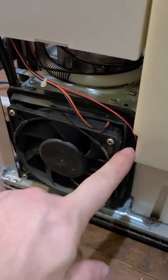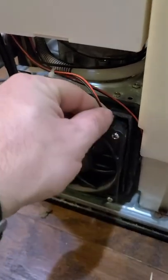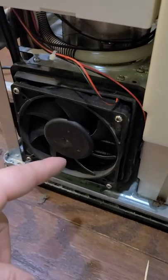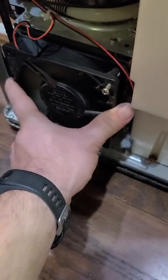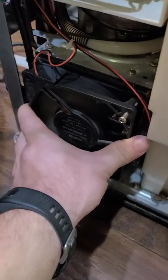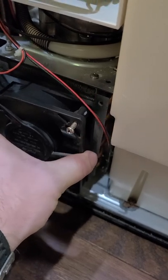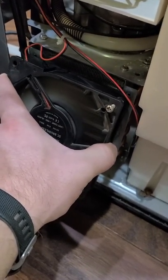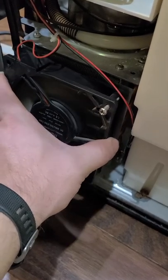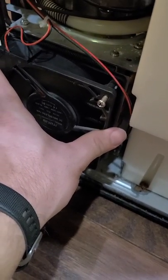To remove the fan, it's just these four screws. It comes right off along with its rubberized vibration mount. What I noticed is my unit overheats and stops making ice. This fan is working great, so it's not the fan. What I did notice is that when I pull this fan off of this condenser, this fan now generates easily five times as much air as the second I put it on there. That condenser is probably a little clogged up and it's also choking off the fan.